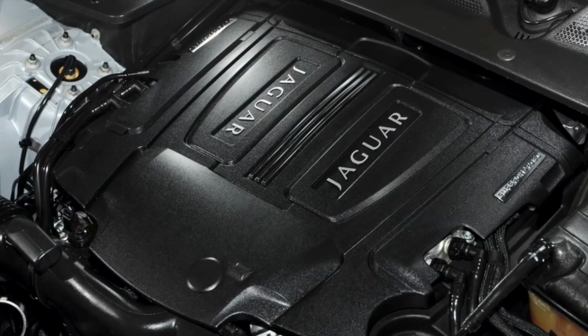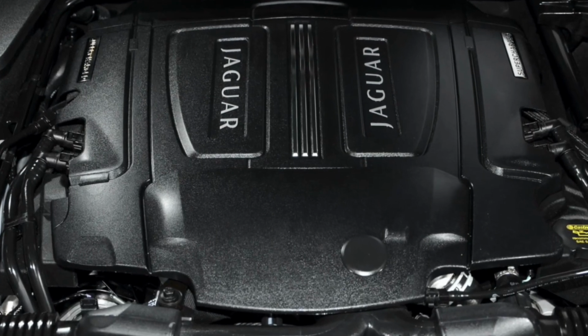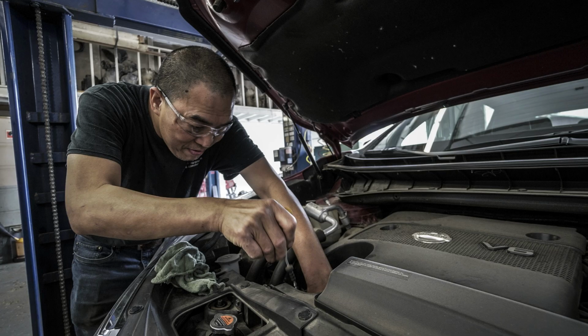Maintenance is not just a mileage thing, it needs to be done at set times. Oil changes are needed annually, no matter what the mileage. And also be aware that cars that have sat for several years will have stale fuel in the tank. At the end of the day, the V8 engine will be good for several hundreds of thousands of kilometres. It's the running gear that will need to keep up with it. And again, with any car, it's the regular service that's important.